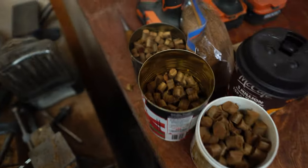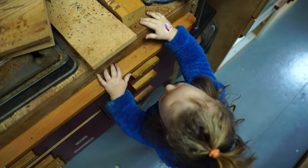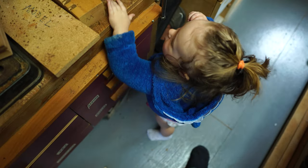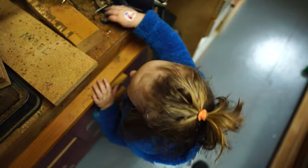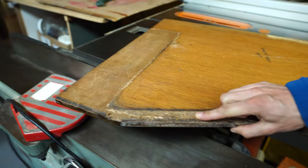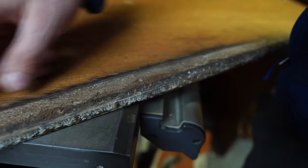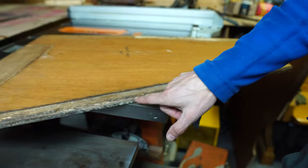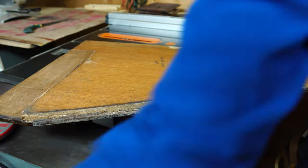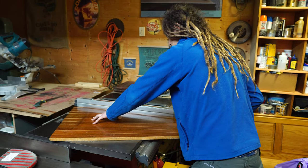I've got the wood plugs going — making lots of them and it's taking me forever. Coral's really upset with the mess I'm making so she's making sure to clean everything up after me. I removed the laminate from this section. The wood's still really good here but it's super punky along here, so I'm going to use the table saw to cut off the section. I just have to get the height right to make sure I only cut about five millimeters. I've been cutting different test cuts to dial it in and I believe I've got it just right.